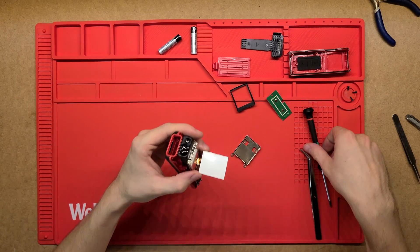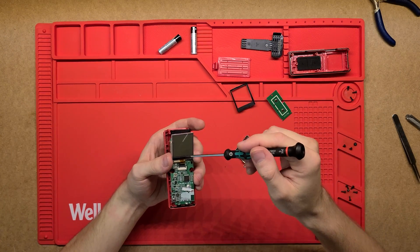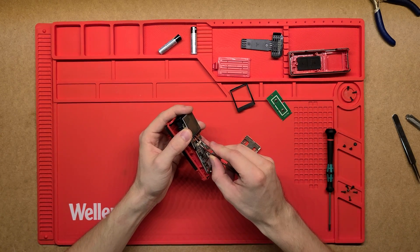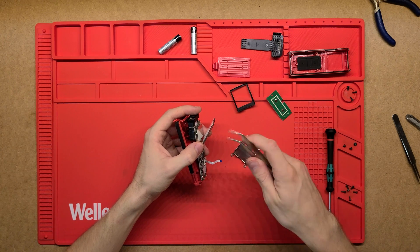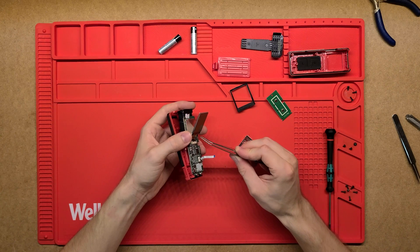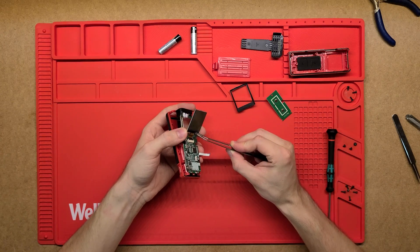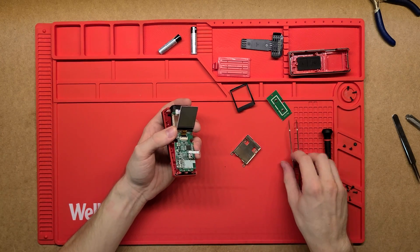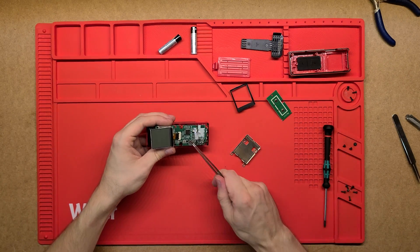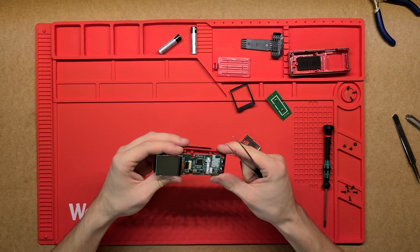Back to the screen — there are going to be some LEDs in there acting as a backlight. I think that very last, very back layer of glass is where the LEDs actually shine into, and then the screen starts here and goes to the end. This black section would just contain the circuitry for those LEDs, which turn on and light up the whole screen. There's also a little clip here so the screen can be taken on and off.